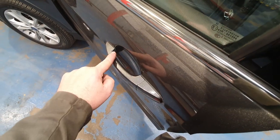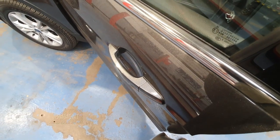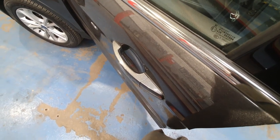It's looking like we've got faulty capacitive sensors in both front door handles. I'll prove it by taking the door handles off, unplugging them, shutting the vehicle down, and seeing if it shuts down properly.